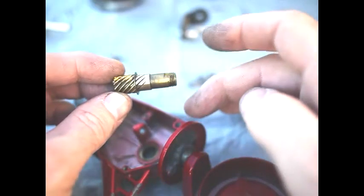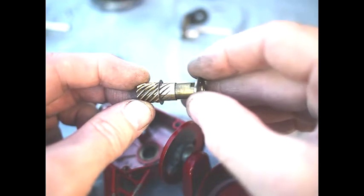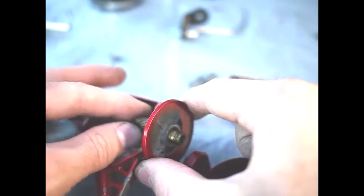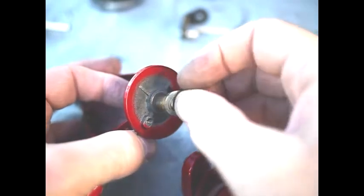and you'll see that sometimes it's actually stuck onto the real body with grease. Just make sure you don't lose that. And there's another washer that goes on, this stops the bearing being nipped too tight, and it only goes that far. That goes on the other side. So you push that through like so, and the anti-nipper goes onto there like that.